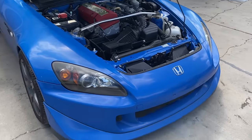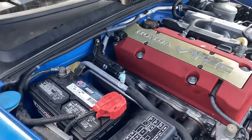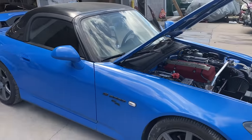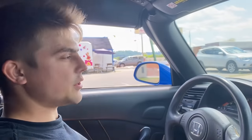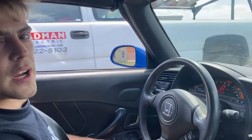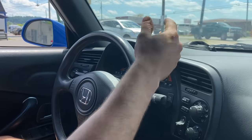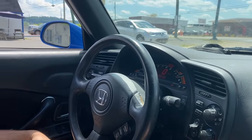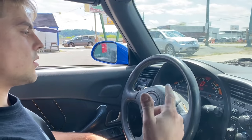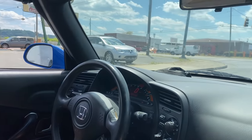We're warming it up right now and we'll get some antifreeze into it. We're going to see if it's leaking — not leaking so far, that's good. We're going to let it warm up so the system can burp. We just got the gasket on, filled it full of coolant, and we're doing a test drive right now. It appears it's not overheating, the heat works, and we burped the system. We went to get lunch and we're going to check for a leak — if there's no leak, we fixed the problem.